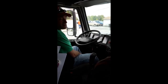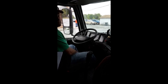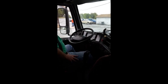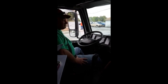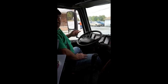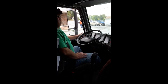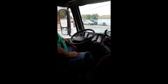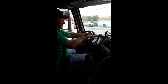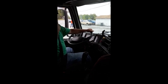Did I miss anything else? Not saying I did, just asking. Because you caught it, it skipped the windshield wipers. Indicator fuel. Right. Thank you. Indicators: right turn signal, left turn signal, high beams, four ways. That's why I say use the review. Go through it in your mind, because as you can see, it'll take a couple of minutes to get your air built up. Use that time to review.